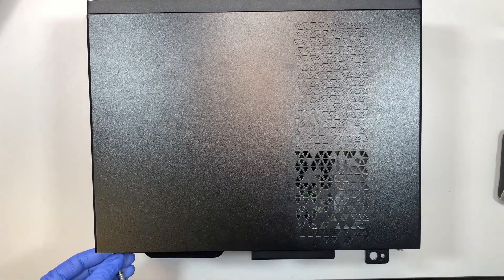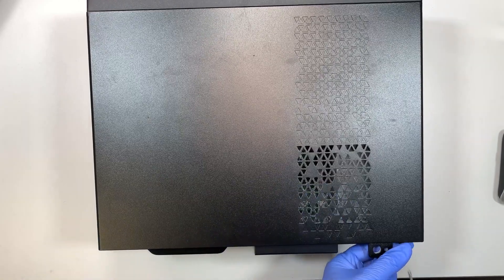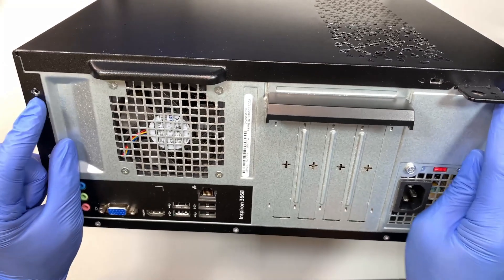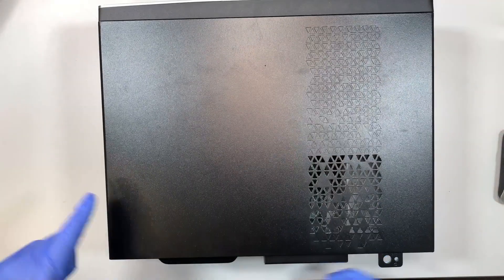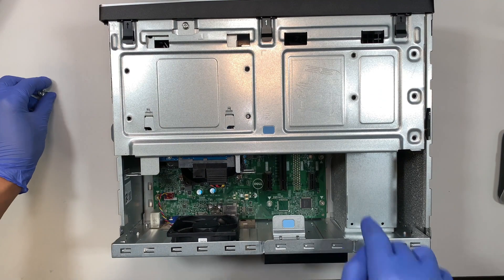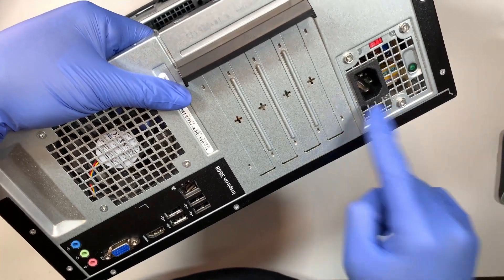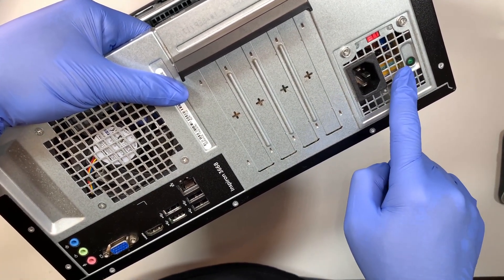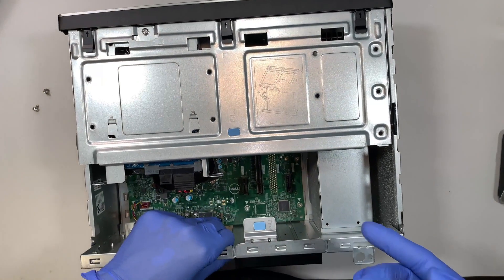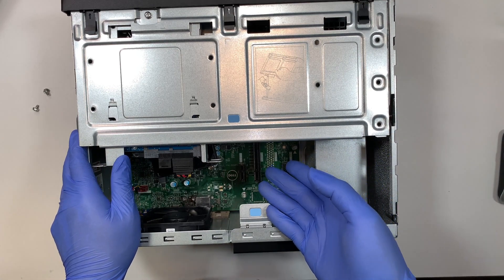We tested out the power supply. To access it, remove the two screws on the side of the panel, then slide the panel down towards you and remove it. The power supply is where you plug in your power cable from the outlet. There is a light on it and it's on, so I know the power supply works. The voltage is stable and nothing is wrong with it. The only next thing to troubleshoot would be the motherboard.